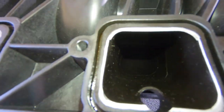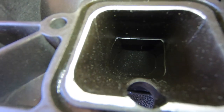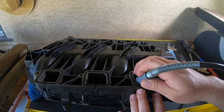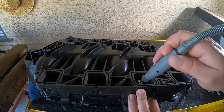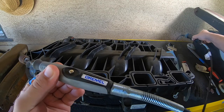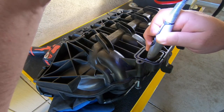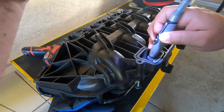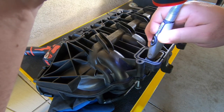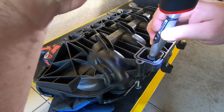There's quite a bit of obstruction on this one — this is the worst port. I started having to use the Dremel to reach all the way inside, because the drill with the sanding paper attachment couldn't reach deep enough. The Dremel with an extension is a really good tool for this. When you're using your porting tool or Dremel, don't put too much pressure on it — let the tool do the work. Don't stay on one spot too long; move it up and down slowly, gliding over the plastic so your transitions are smooth. This technique will work with any intake manifold, not just this one.